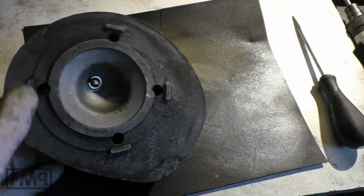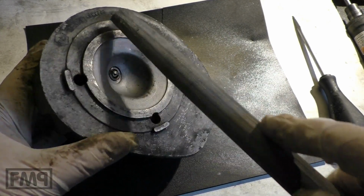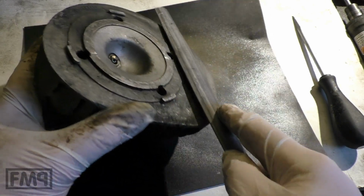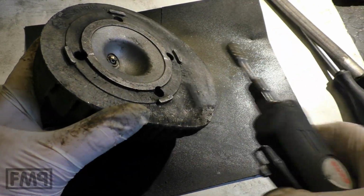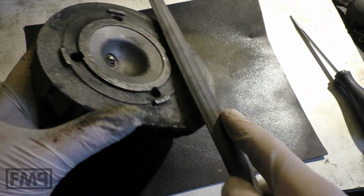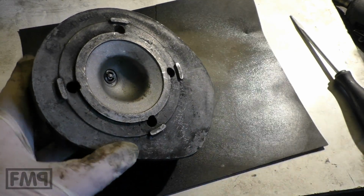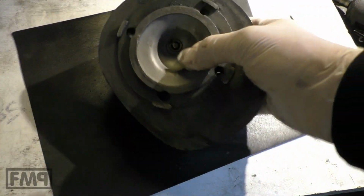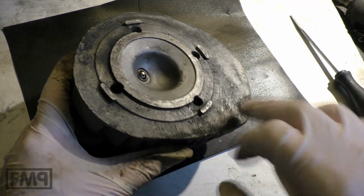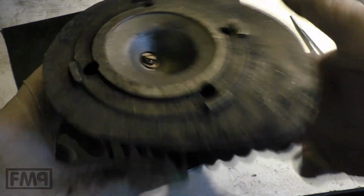There's something special about the PX200 cylinder head. They do have these additional 4 beams, and in my experience, before you remove these or lower them, you can do it with the miller. Just make them way smaller and then sandpaper the sealing surface of the head, and the head will be tight. But as long as these 4 beams are here and not touched, this head is never gonna be tight.